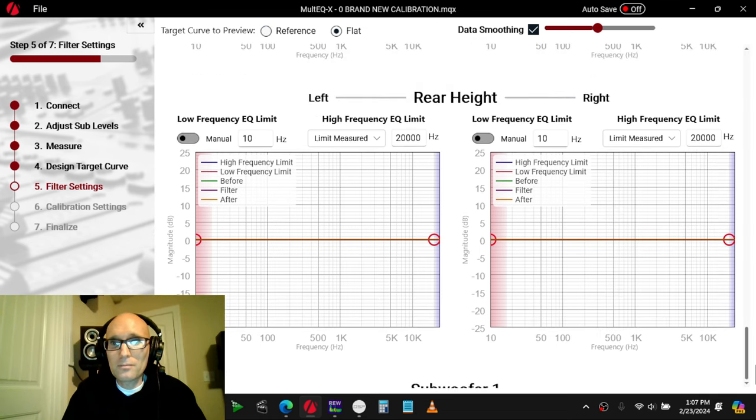So now we go to the receiver. On a Denon, you go to speakers, manual setup, you go to bass, and LFE low pass filter, 120 hertz. Set it to 250 hertz. What does that mean? There's no filter applied right here, right? The response is going to be from this, but this is 80 hertz, right? So this is going to come here because the filter's not applied.